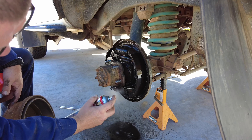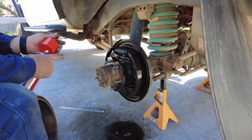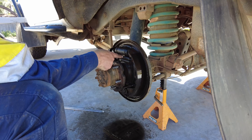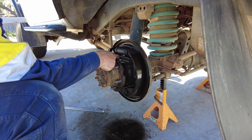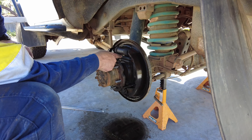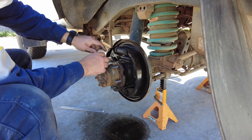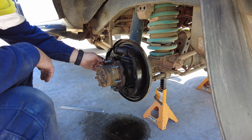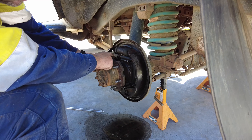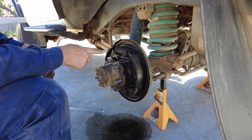What I'm going to show you here is the self-adjuster. When you're rebuilding or replacing the brakes, you must remove the self-adjuster, clean it up, and put a good amount of anti-seize on the thread that goes inside. Also make sure there's a little anti-seize on the pivoting points and moving parts inside, so this works fairly freely. The little lever is meant to rise up when it's loose to the next click and then adjust down in small increments.